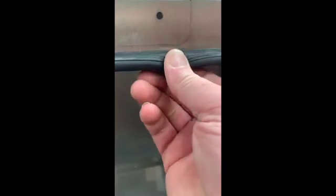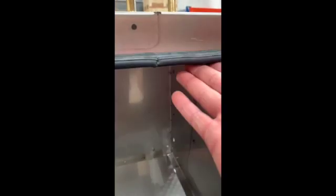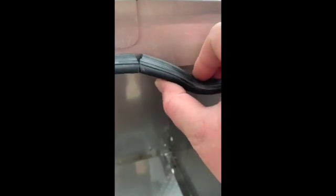Final stages: fitting the door seal. Set the seal join at the top of the door, ideally. When you come to fit this, the seal will seem to be very long — about an inch or a bit longer than it looks. It needs to be that way because the rubber contracts over time. The best way is to force the edges together and then try to pop the seal up into position. You'll find the seal will fit — it'll be very tight and feel like it's too long, but over time you won't end up with a gap.